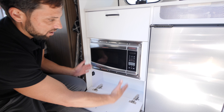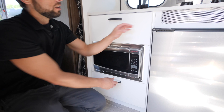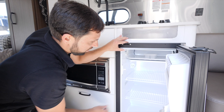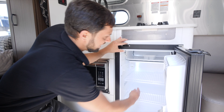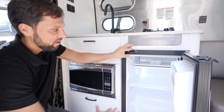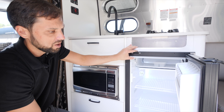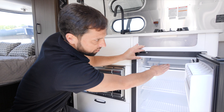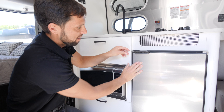The NovaCool compressor-style two-way refrigerator runs on 12-volt or 120-volt electric. It cools very quickly — it's already removing heat after about an hour. The door looks small but it's very deep, giving you 3.1 cubic feet — a big advantage over absorption-style refrigerators. The top portion is the freezer and the door has additional storage. It has a metal latch to keep it shut while driving and another latch for when parked and not level.